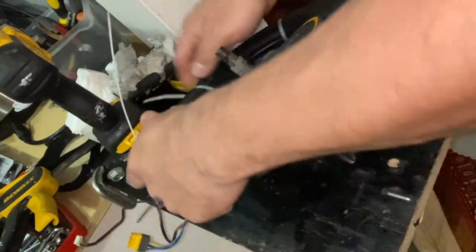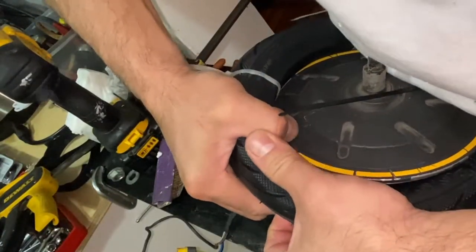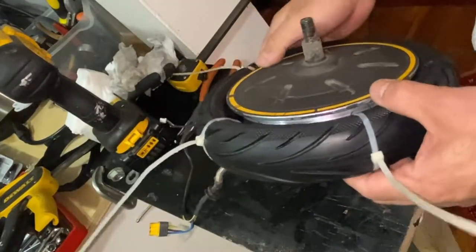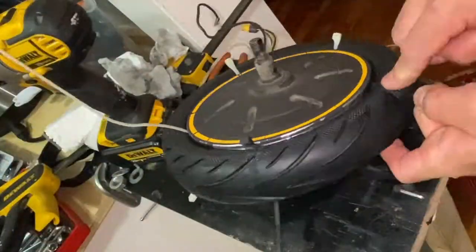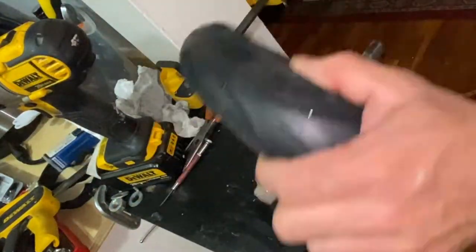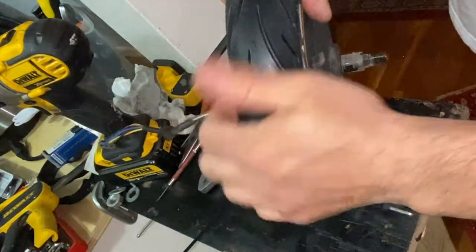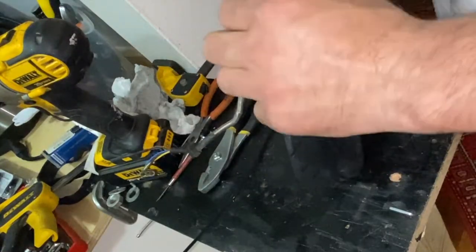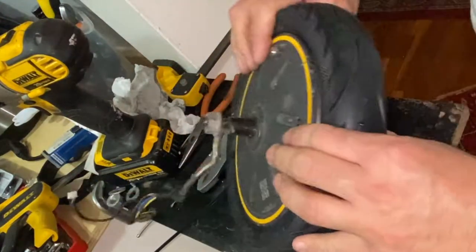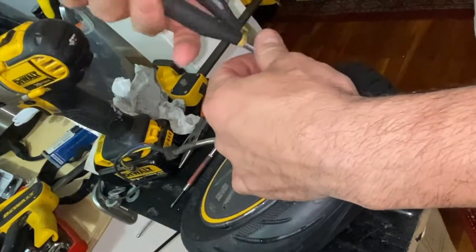When you're ready to put the air in, it will sit normally. An important point: don't put the zip ties on and leave them for a long time — you have to do this quickly, as fast as possible. When you cut the zip ties, don't just pull them out. Put the pressure on the part where the zip tie is, so the zip tie comes out clean and doesn't make a mark. Then it's important to push the tire around so it gets in position before pumping air. We're going to add a little bit of soapy water to help the bead slide into position. The ring should be completely clean so there couldn't be any problem — the tire will sit properly and quickly.